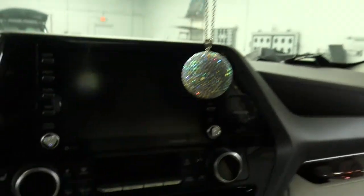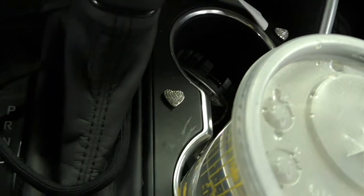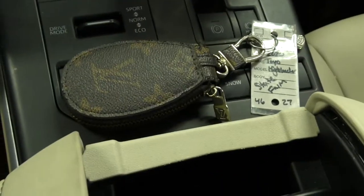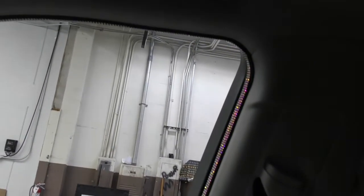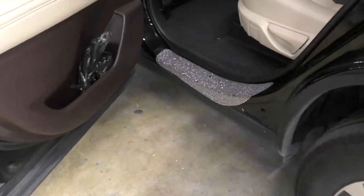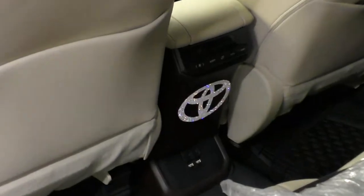Now, I don't know if these are little plastics, if this is metallic. The radar sensor actually transmits high frequency radio waves. And the only thing that distorts it or bounces back or gives you any kind of reaction is a metallic. If these little crystals are made out of plastic and they just create a little glitter, yeah, we can see it, but that doesn't mean the radar is going to reflect it. So I'm going to go ahead, measure the car, and do an alignment the way I do every car.